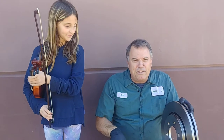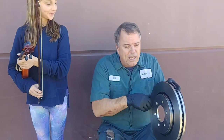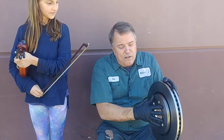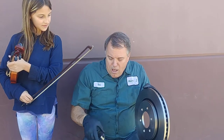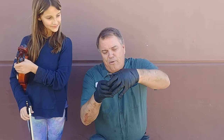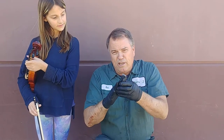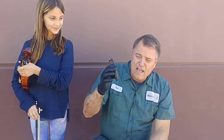Some of the things we have to do when we're doing a brake job is make sure that all of this is clean — no greasy thumbprints. This is where the difference between a high-level professional and someone less professional shows. Also, these brake pads rest inside some brackets, so we need to lubricate them, and we also need to put some lubrication on the back of the brake pad. And lastly, there's the quality of the brake pad.